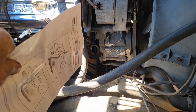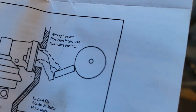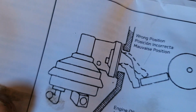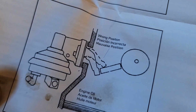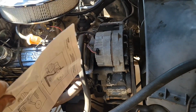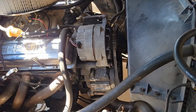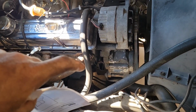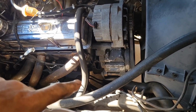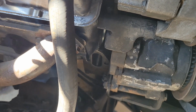Okay, so I'm not able to get the rod moved forward at all, so that must mean that the top of the lobe is actually pushing down. Just from how it's spaced out, that is pushing the rod downwards, so it would normally be in the depressed position for my fuel pump. So I need to rotate the engine and just crank it. All you have to do is a quick bump, and that should move the lobe across, and that way we'll be able to move the rod up. You're just going to keep doing that until you get more ability to lift it up.